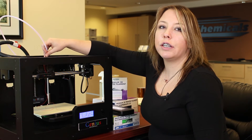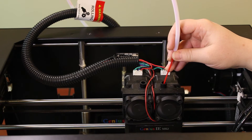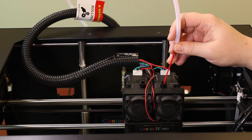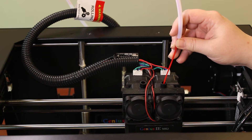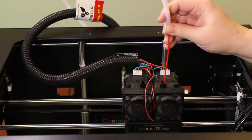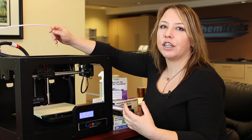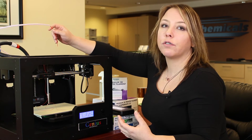If you're doing this manually, you would push through about an inch of material first, and then start pulling it out slowly. Try not to pull it hard, otherwise you might cause it to snap inside of the print head, which would give you a jam and makes it much more difficult to deal with.